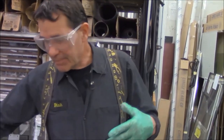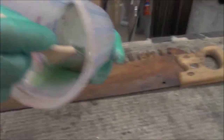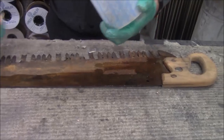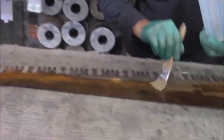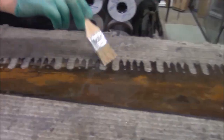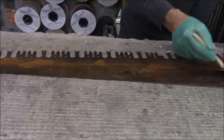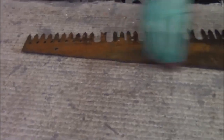So I'm going to take my time. This product is like water — very thin. We apply it where the rust is thicker, where the rust is heavier. What this does is, besides pulling the oxygen out while I'm applying it, it is also loosening all the easy rust. The easy rust is the loose rust on the surface. We put this on, we're going to let it set for a while, possibly put a second coat on, and then we're going to take a piece of plastic steel wool — not very hard — because the rust is being loosened up by the phosphoric acid.